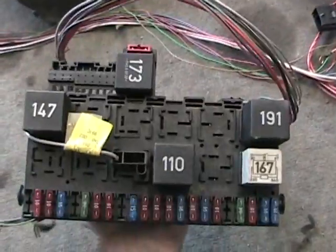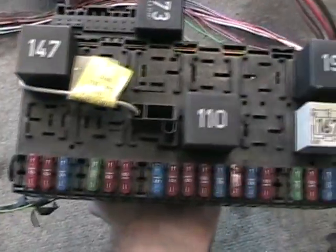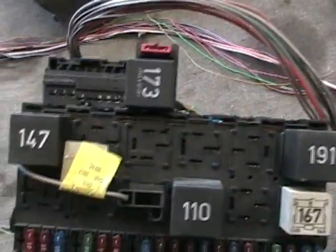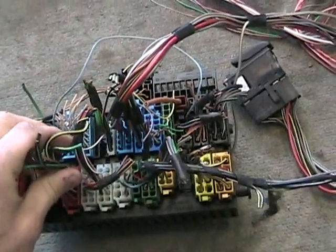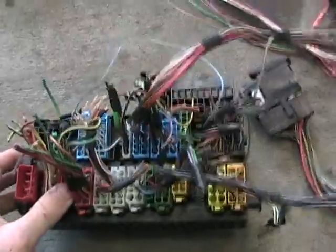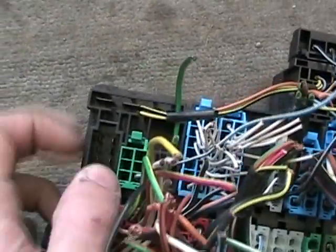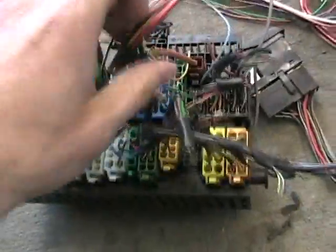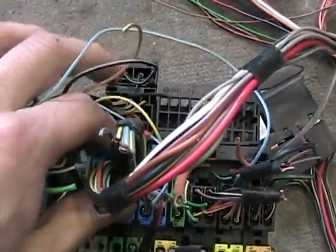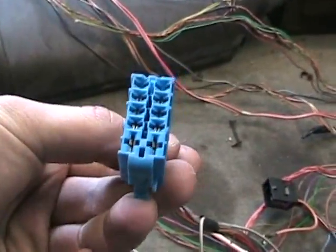What we have here is the familiar Central Electric 2 fuse block, and you've probably had to replace a fuse at some point, but I don't know if you've ever seen the back of this. All the wires on the car come back into this panel. In the middle of the panel there is a locking tab that slides — locked, unlocked — and when it is unlocked, you can pull a connector out by depressing this little tab.